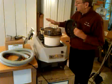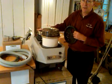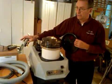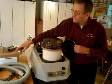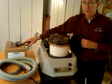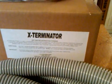You can remove this lid and take a bucket and fill this stainless steel tank with three gallons of hot water. We recommend that you put your steam detergent in first. The product we recommend is called Exterminator — you use two ounces to one gallon of water. It's in powder form and dilutes very easily in the hot water.